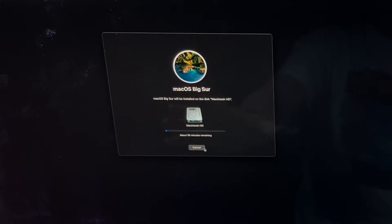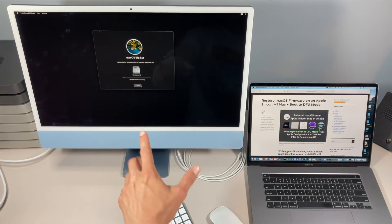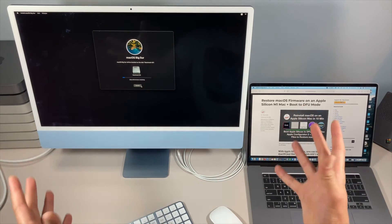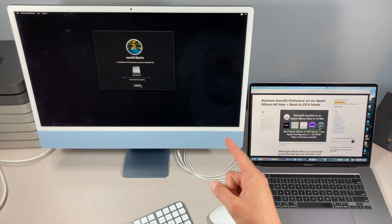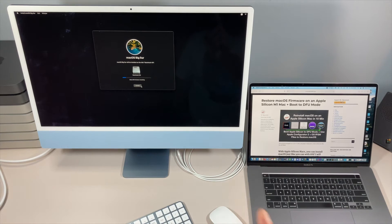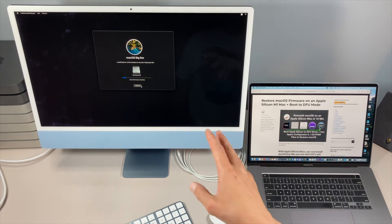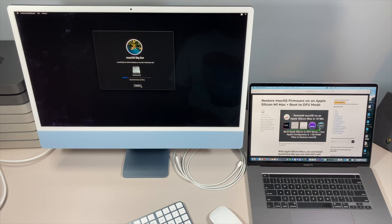Go back, click Reinstall macOS Big Sur, Continue, Continue, Agree, Agree, select Macintosh hard drive and click Continue. One thing you'll notice right away compared to macOS recovery is instead of three hours you'll see '59 minutes remaining,' and it does go a lot quicker — usually 30 to 40 minutes to fully install Big Sur from the USB flash drive. If you see it jump to two or three hours, you're installing over the internet; restart, hold power for the boot picker, and make sure you select your USB flash drive.